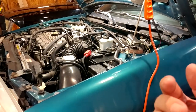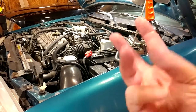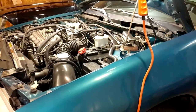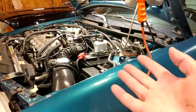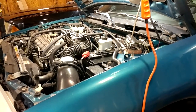So what I do is get the axle shafts out and replaced, but I leave the last one out. That's when I drain the transmission oil, and I fill it up through the axle hole in the side of the transmission. These cars have something like a four-pint capacity — we'll double check that. I measure out that much oil, make sure that's what I pump in, put the axle back in, and I'm good to go.